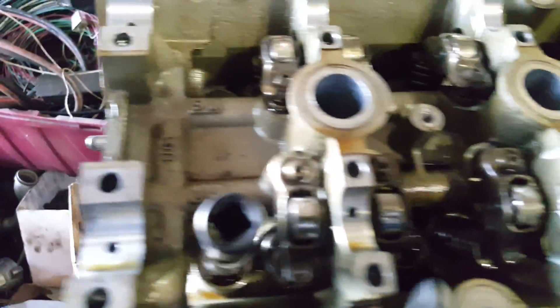To remove the one behind the pulley, it's going to be another 8mm — two bolts, one here and one through here. Get that one out, lift the cam, and there goes the cam itself. Put them aside.